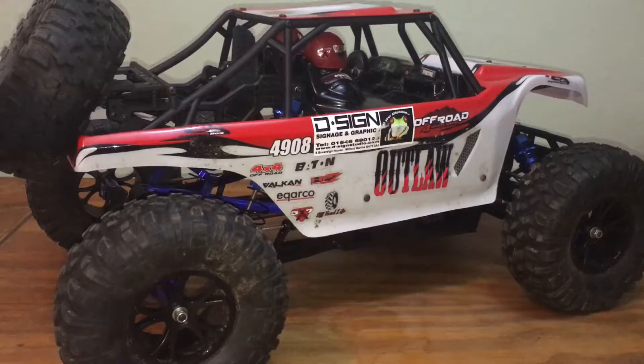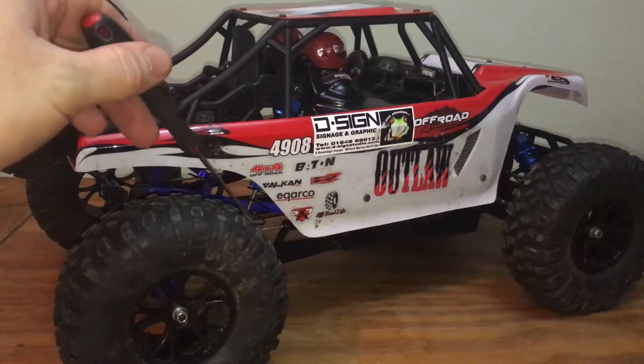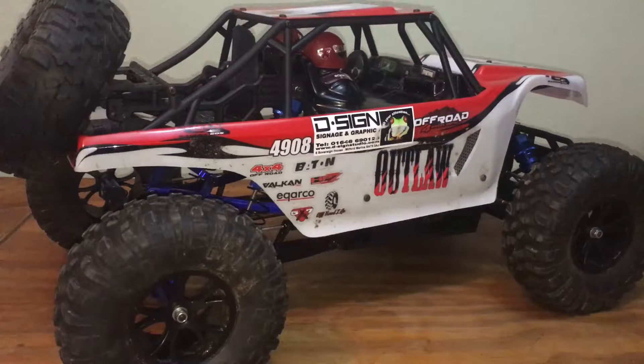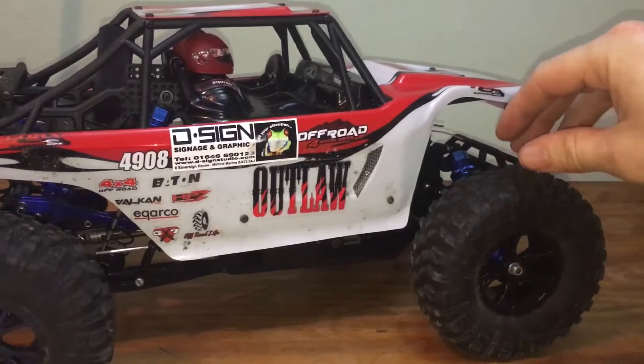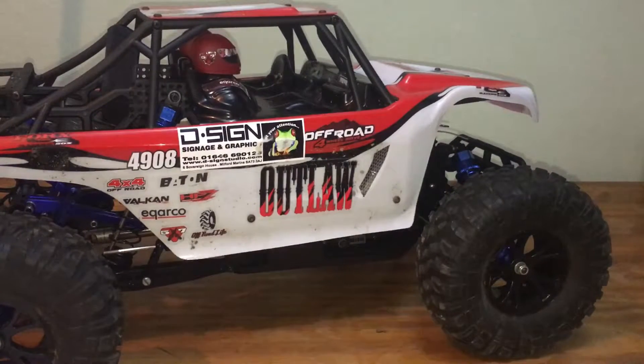Here's my outlaw, folks. For those of you with sharp eyes, you might wonder what this is nestled under the body. This is my custom rear sway bar, or anti-roll bar if you want to call it that. When I first bought this car I could see hints of it lifting the front right-hand wheel, and that was just running the stock motor on the 3S LiPo, so I wasn't very keen on that at all. And when it became brushless soon after, the problem just became more profound.